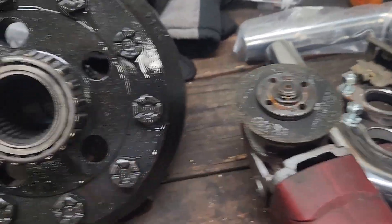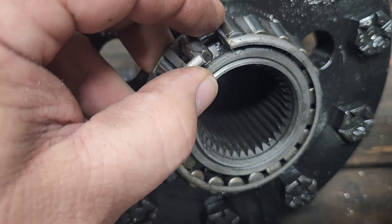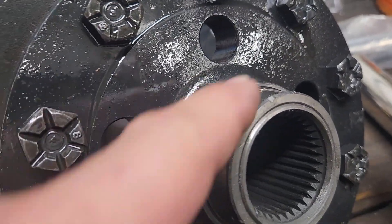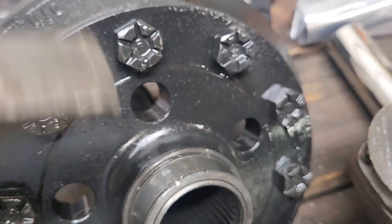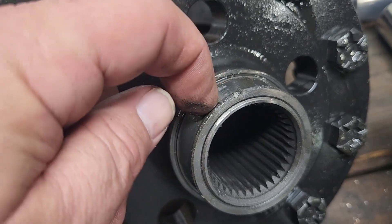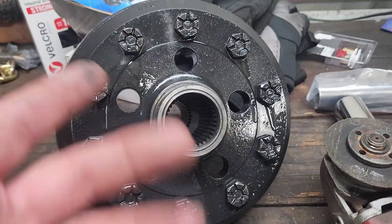That's why I keep my small cut off wheels - couldn't hardly get a big cut off wheel in there. I cut through that and now we can just pull it off, and the needle bearings are going to fall everywhere. That's what we're left with. Now you can cut through this if you want to - cut through it so far and then use a chisel, and once it pops apart it'll pull right off. But I've got a puller, let's just pull it off. Or you can use a press.